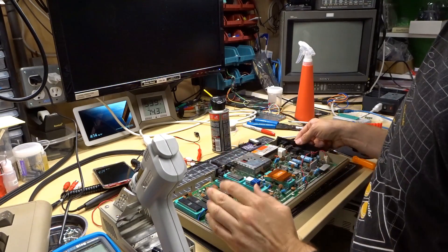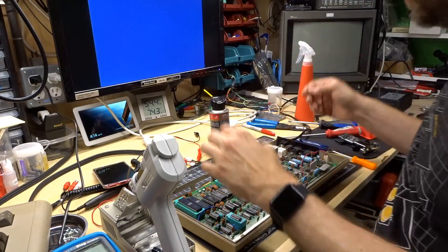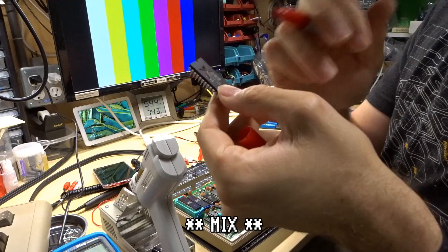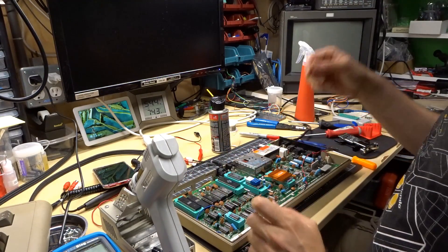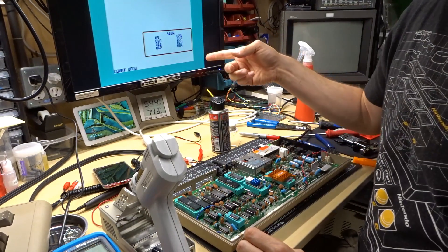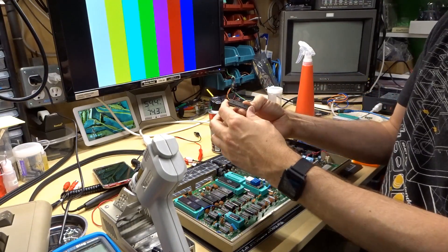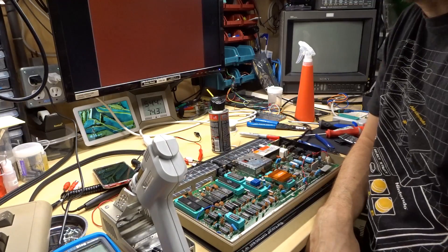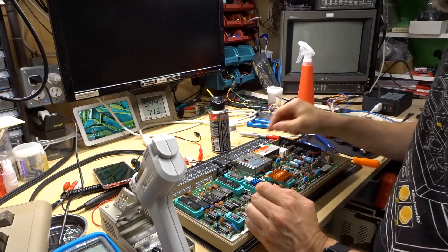Take out the known good PLA and put in the one I just desoldered. With ZIF sockets you're not pushing into a socket, so I don't have to worry about cleaning up the pins first. And look — it's not working. It has a slightly different effect in this one — we're getting a blue screen versus the orange screen. I'm going to draw an X on this bad chip so I don't mix them up. Let me put the good one back in to confirm my machine is fine. Then put the chip with the X back in and let it sit on the dead test screen for a moment — and there it is: brown and blue, flashing exactly like the other machine. Well, that clinches it — that PLA is bad.